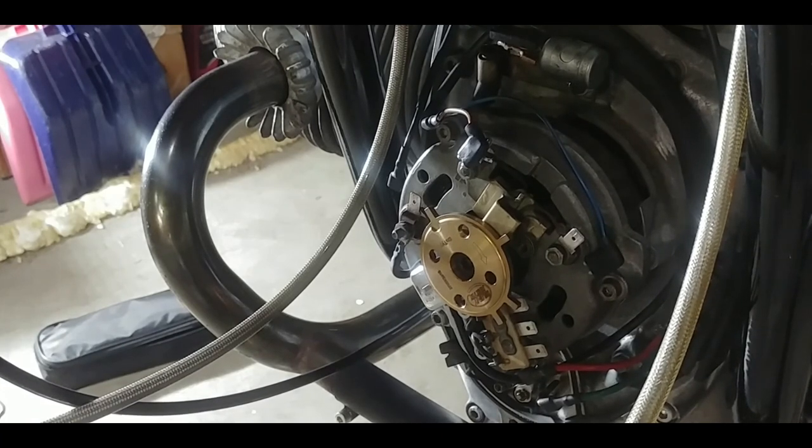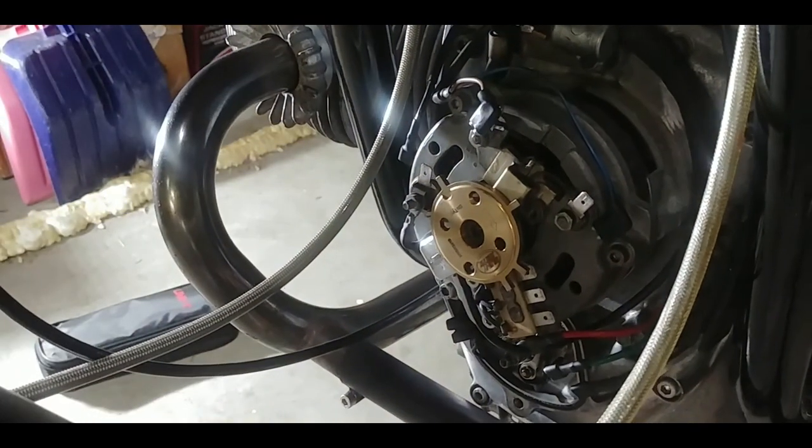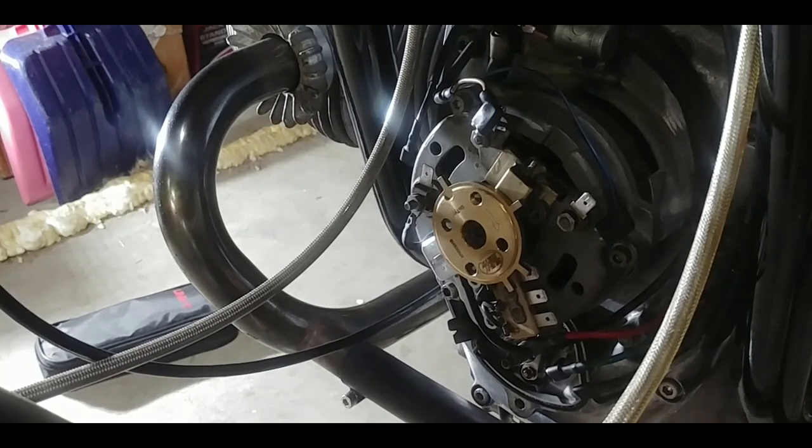So now I have the rear wheel off the ground by just putting a jack stand under the axle. I have it in high gear. It's a little easier if you take the spark plugs out but that's not that important right now. Now you just bump your wheel until we have that one nose. I marked it with a sharpie and now I'm going to line it up right with that punch mark. There's a little center punch dimple in here — that's perfect. So now I know that my engine is more or less timed and now I can take this rotor off without having to figure this all out again. Of course we have to check timing once it's all back together and probably adjust it a little bit.